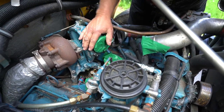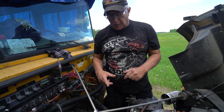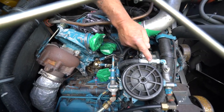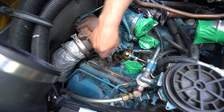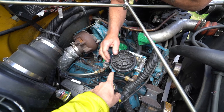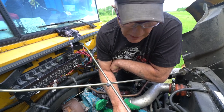The International system is great because it's only thinking it's running on diesel. But when you put it to veggie, it changes the whole ballgame — you have to tell the engine what you want. So we're going to tell it we want it to run on veggie oil. The fuel line comes up from the high pressure pump, through this line, down here, into the head — the left front head, not the right. The right head comes right from the pump. Anything over 35 psi is bled through here back to the return line, which goes right back to the tank. About 90% of your fuel coming out of your engine returns to the fuel tank. This is a mechanical pump with no regulation, so they regulate it with 35 psi — whether you're idling or going down the road at 60 miles an hour, it's still 35 psi, just continuously pumping fuel through the same cycle.